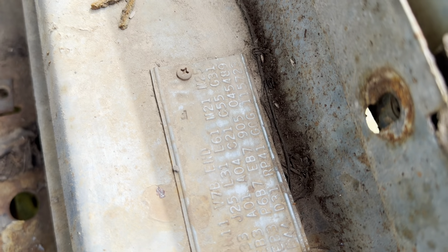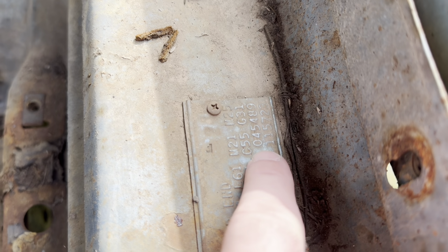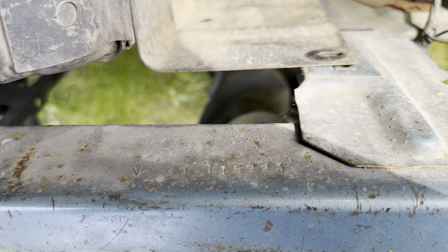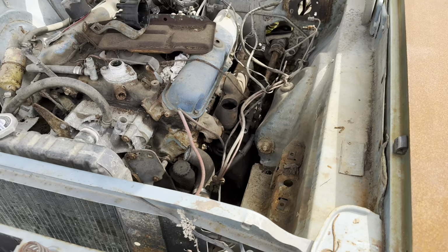You can see that matches the fender tag, matches the VIN, matches the door sticker. And then on the VIN, it's OG last 6. On the body stamping, it's plant and then year. I don't know why they reversed that, but that is correct. So that's where it is on a St. Louis car. And there's always 2 body numbers on every car.